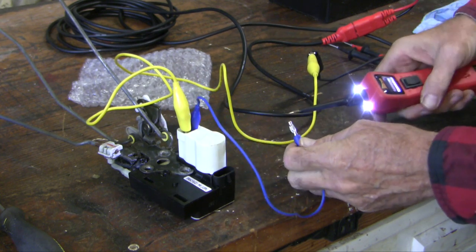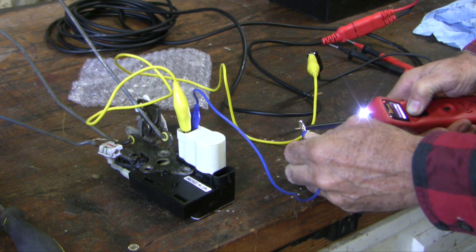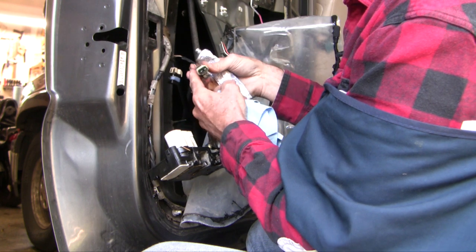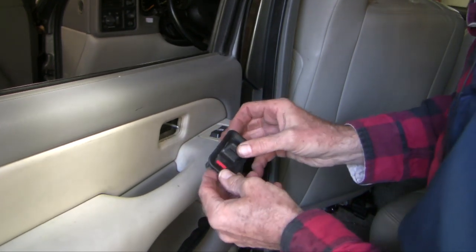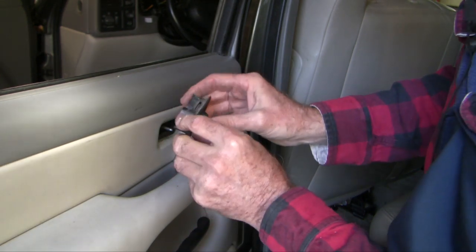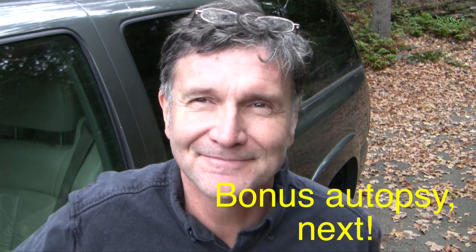Let's see if this new device works. I'm going to apply 12 volts with the power probe — if you don't have one you could use a fused switch. It seems to work. I'm putting a little dielectric grease on the connectors to try to exclude water from the electrical connection. A trick to speed up workflow: take the device off and when you put it back on you can more easily line it up. This end hooks in with little hooks — just pry those hooks out and it comes out easily. Make sure the red mark is on the back side. Thanks for watching, I hope it helps with your repair.